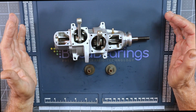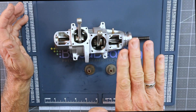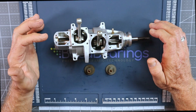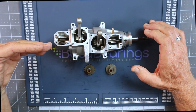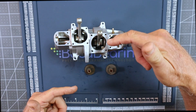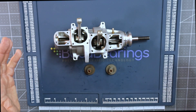After everything I've gone through, and after a long conversation with Harvey where I sent him more pictures, I still believe the front was potentially correct and I mistimed the rear cylinder. Jeremy, a friend of mine, helped me find an RC groups thread where two people with this engine were discussing how to time it. I think the mistake I made was rotating the rear cylinder only 180 degrees when I should have rotated it 360 degrees.